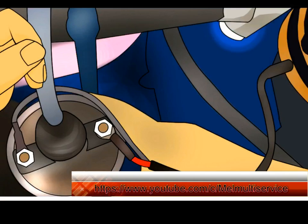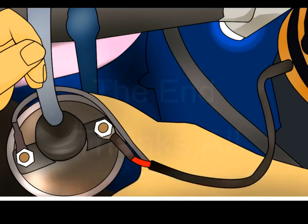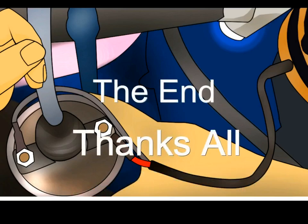Step 7: Reinstall the ignition coils after replacing them as needed. Once all of the ignition coils have been tested, replace any faulty coils and reinstall the rest of them on the vehicle. Make sure to reconnect all of the electrical connectors and reinstall any engine covers or other trim pieces that may have been removed. Ignition coils are a very important part of the ignition system and can dramatically affect the engine's performance when not functioning correctly. A failed coil can cause all sorts of problems, and testing them will ensure that your vehicle stays running in top condition.